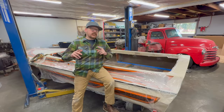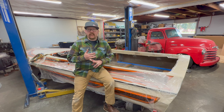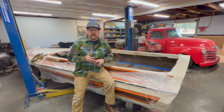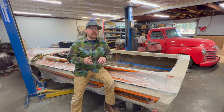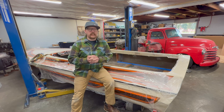All right, so I'm not sure which video is gonna be coming next on the jetboat series. It's either gonna be addressing all the fiberglass and getting it prettied up and ready for the gel coat that we're gonna do over it, or I'm gonna go over the intake, because this boat did not have a shoe or a ride plate, and I've had the intake machine for those items. So we need to get that intake mocked up and be sure that the shoe and ride plate sit happy with the keel and make sure that there's no further fiberglass work there. Not sure which one of those two videos are coming. Those are pretty much the last two videos, I think, that we're gonna be dealing with fiberglass, and then we can move on to other aspects of this build.